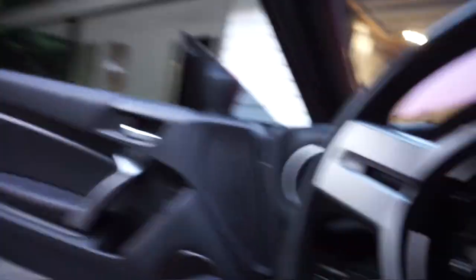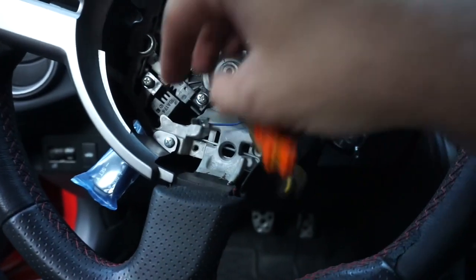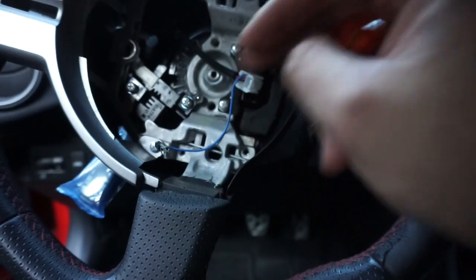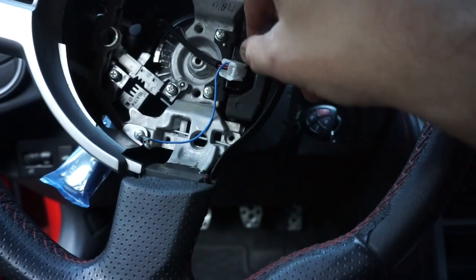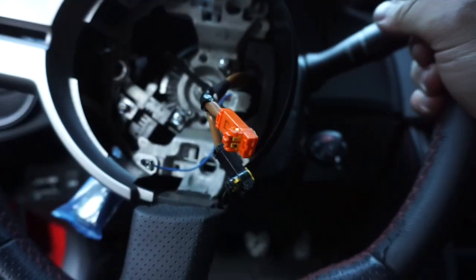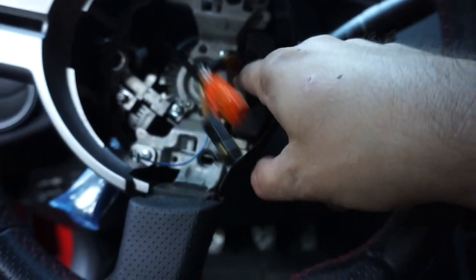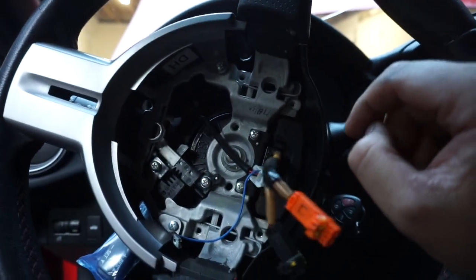I guess you'd say this is kind of a failed video, but that's okay. I do want to make it purposeful — every video with this build I want to make it better, but sometimes you do have losses. This is kind of a loss. I needed that wire and they didn't sell it separately, so I'm glad I bought the assembly because I needed it. I thought reconnecting the negative would fix it, but it obviously didn't — we do need a new clock spring. How we're going to get a new clock spring is I'll order one, and then we'll use probably a 19 millimeter to pull off the steering wheel and then install a new clock spring, which is pretty simple. It's this guy right here. So let's go ahead and order a new one.